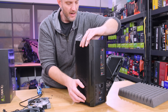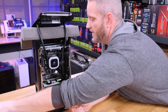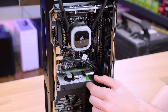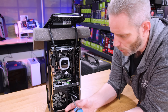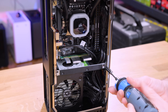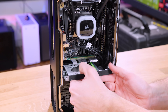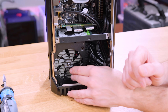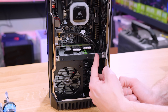Looking at the inside of the system, you can see everything crammed in here. The hard drive is right here — a two terabyte hard drive that I mentioned I'd probably change out to an SSD. I'm considering going with a one or two terabyte SSD, though the two terabyte will be about a $300 upgrade. For now the hard drive's probably fine — it's basically just a notebook drive. To upgrade it, don't undo the screws you might first think of. Instead, there are two screws on the side that let the whole tray slide out, and then you can rotate it to access the SATA and power cables. The power supply is a 600 watt Corsair — standard SFX size, not the extended SFX — with regular modular cables twisted and tied off to the side.